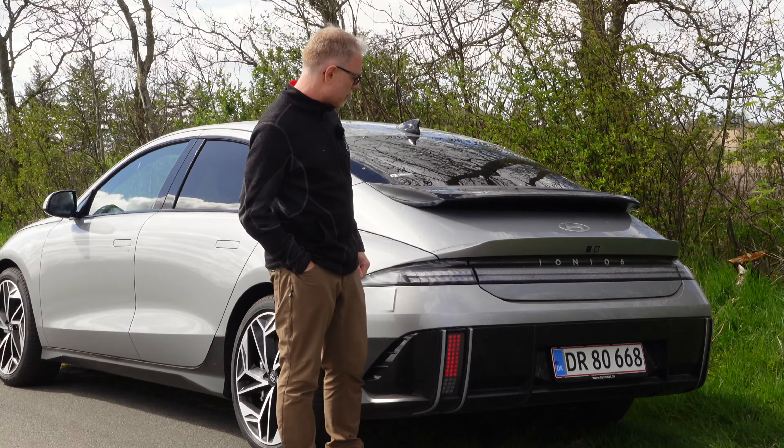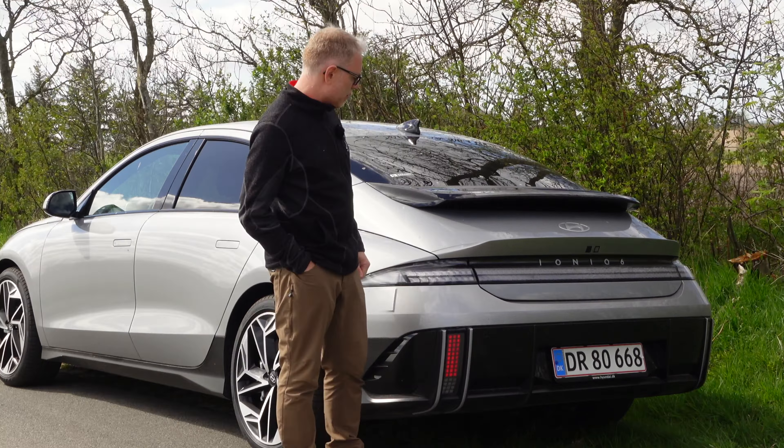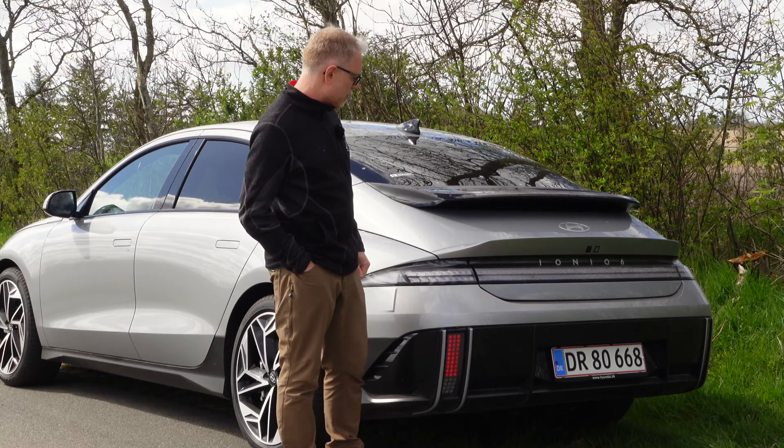When the air passes the roof of the car, it also ends up at this large rear spoiler, which is quite special for a car like this. This spoiler provides a lot of downforce to the car, makes it drive better. And it also works together with an extra spoiler, and that actually creates less drag. Drag is not good for efficiency, but that's a pretty clever design. And even though the rear maybe looks like a Porsche from the 70s, I actually kind of like it.